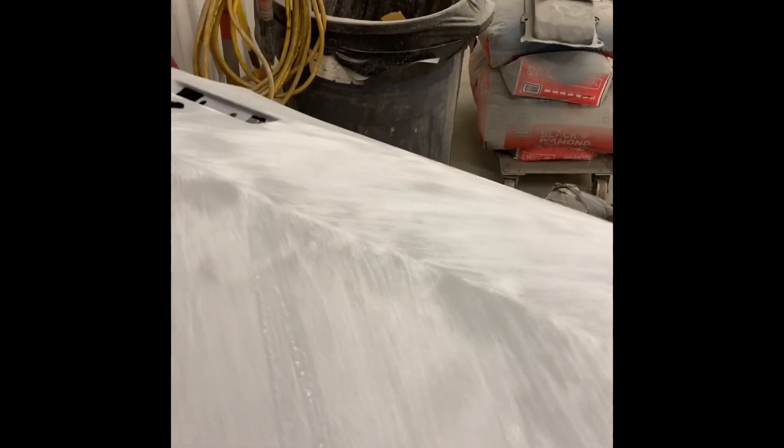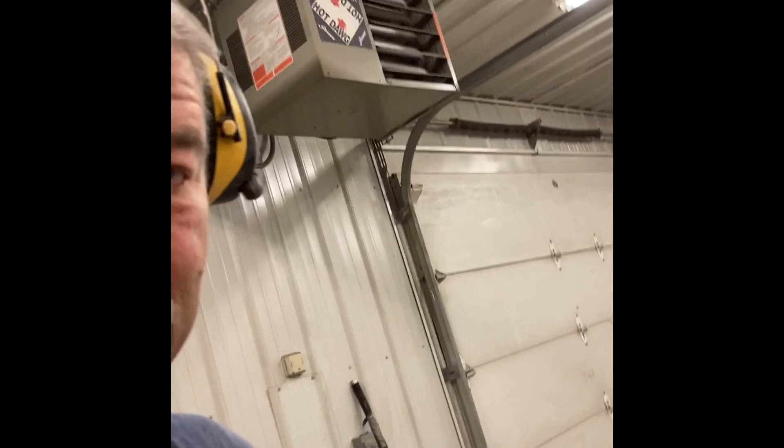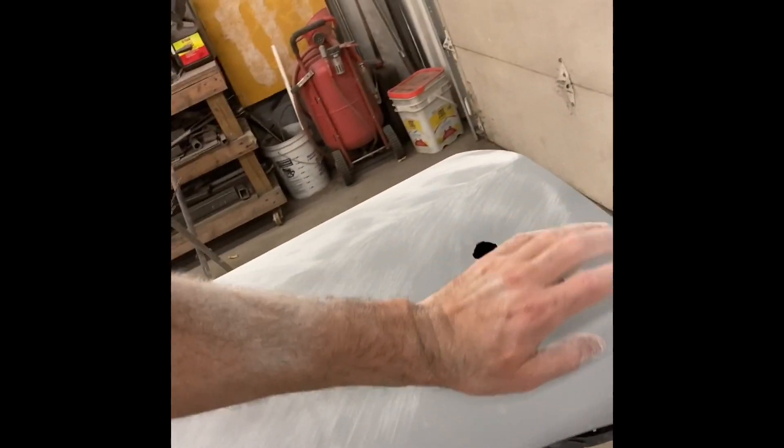You're not seeing dings where it didn't touch at all. When I did this, I did one coat here and then two more, so it's built up a little more than everything else. After you've done a few of these, you figure that out — just put on an extra coat. Up here on top you can see the same thing. There's no low spots, just some little waves here. You usually get a lot of waviness around here from people putting their hand here, slamming the door, or pushing on it when it starts getting hard to shut.